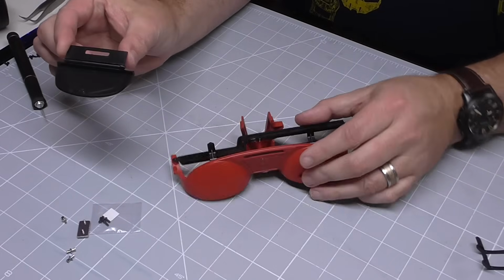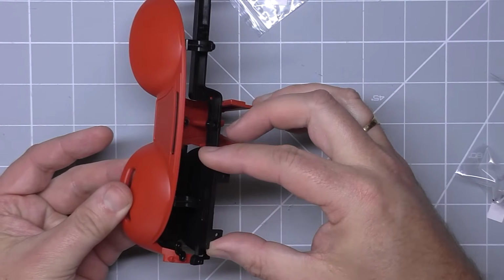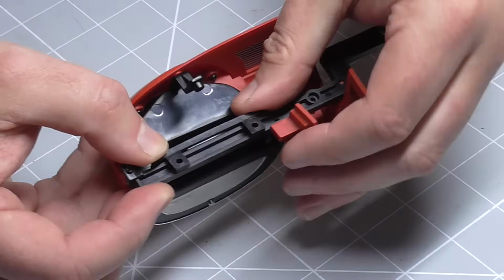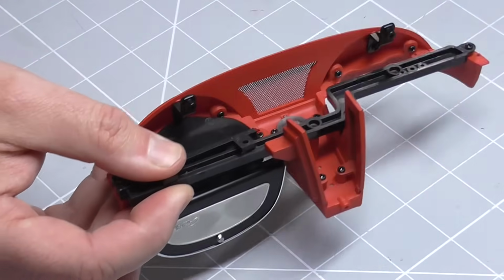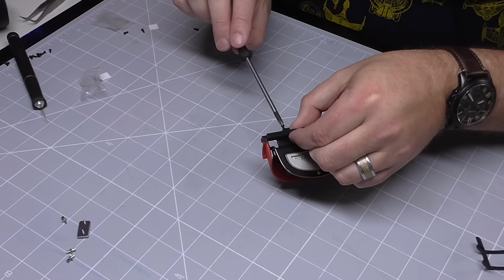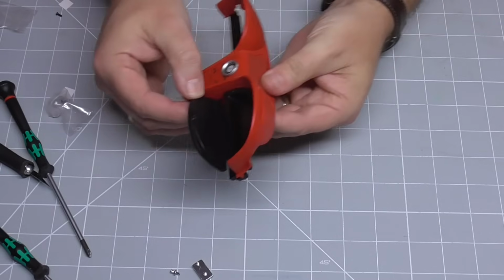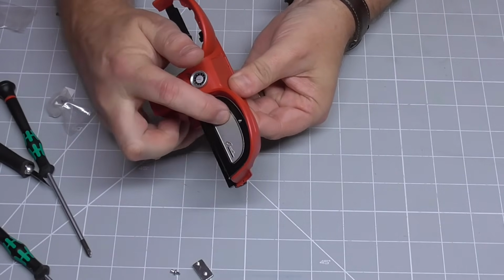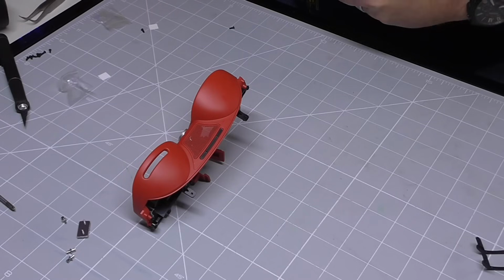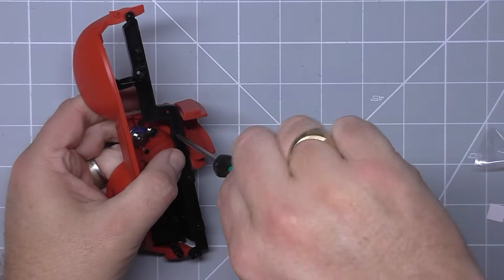I'm then in the position to take the glove box that we've created here, and having it this way round, slide this underneath so that I can actually put these two hinge points just on the frame there. And then using these FP screws I've got, hold that into place. And then once that's locked in, you should be able to shut the glove box like that. With the last FP screw I've got, I can now put a screw down the center of the frame here.